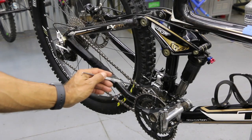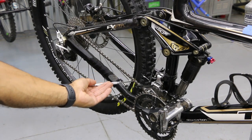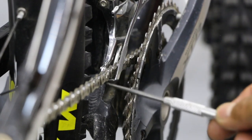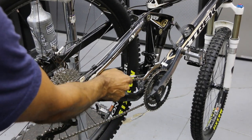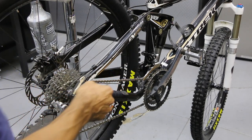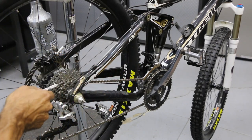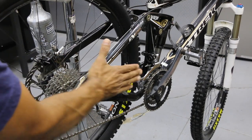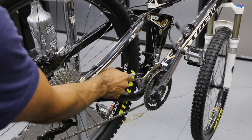Your question was about adjusting the front derailleur when the chain is hitting the outside cage or the bottom. The chain is hitting right there on the bottom. On most full suspension bikes you're going to run into this problem. Right now we are in gear number one, which puts the chain far to the left. If we're in the front left and in the middle or to the right in the rear, the chain will be cross-chaining and we'd likely be hitting the inside of the cage. But this is different — we're hitting the bottom right here.